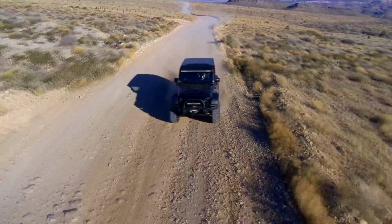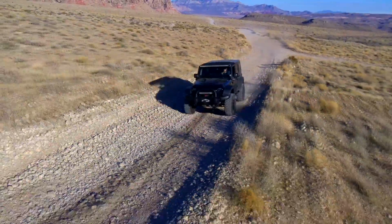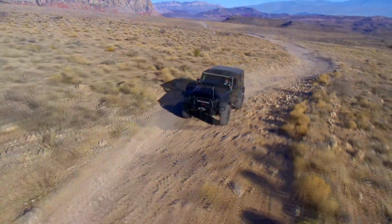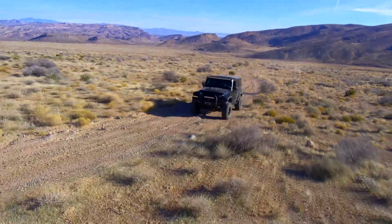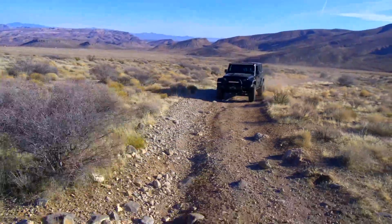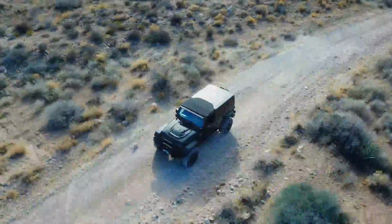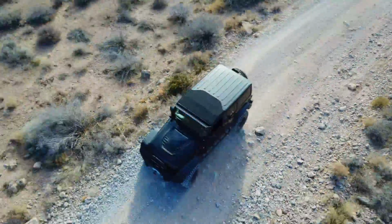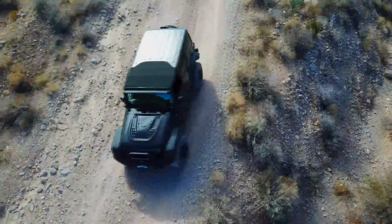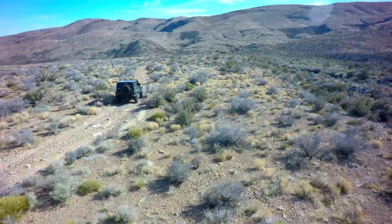What some have done is put an LS in place of the Pentastar engine, then use the Chrysler computer to operate that LS engine. So essentially what we're doing, we're fooling the ECM to think that it's running a Hemi. Cam sensor, crank sensor, all are replicated in the LS engine, fed back to the computer. So the computer thinks it's operating a Hemi. Now the advantage of this is you can run the stock transmission with an adapter. You can add trigger wheels and other electronics to mimic the signals of the Hemi, put the LS into this vehicle, and it's going to run with the Chrysler electronics. Therefore, you're going to have similar functionality to the Chrysler electronics.